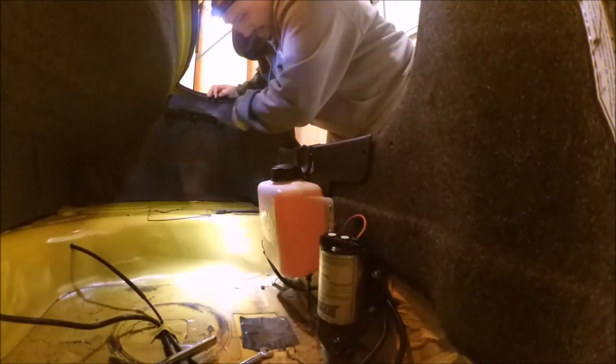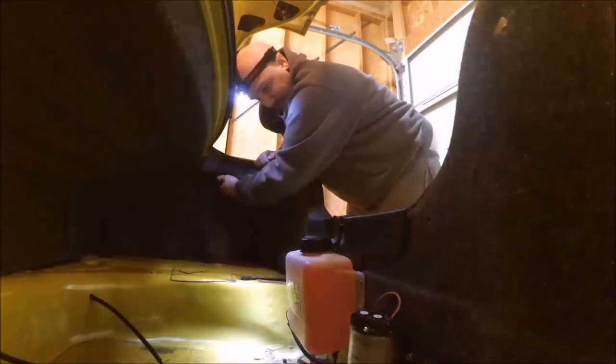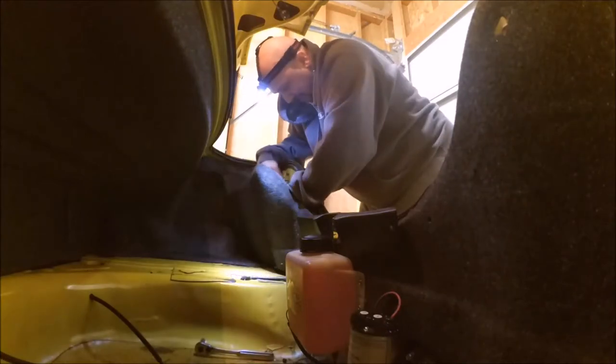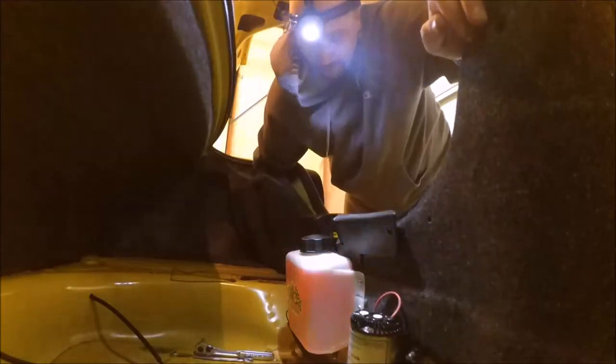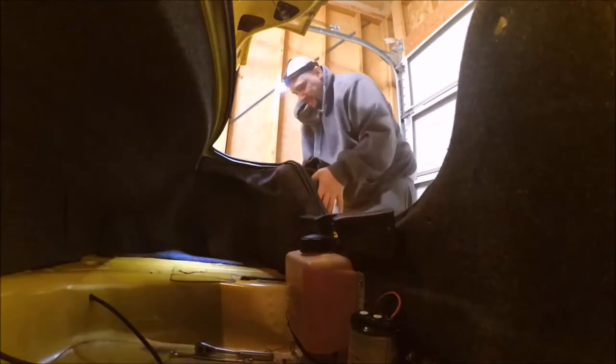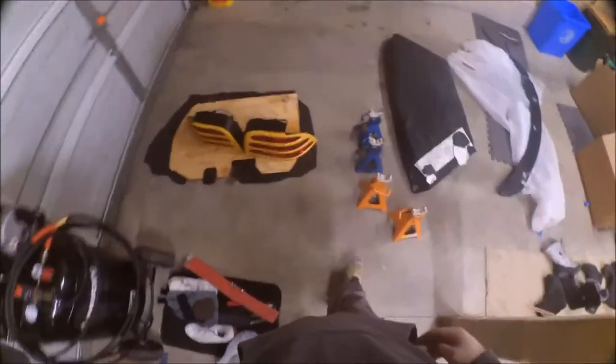We're gonna get the screw pin again. You can see that rubber seal — this is where the panel popper comes in handy. You can kind of pry in there a little bit and pry these things out. Trying to do this with one hand is tough without scratching my bumper up — but this bumper's messed up anyway. I'll stop the video and we'll be back once the old tail lights are out and we get the new tail lights out of the packaging and get the harnesses transferred over.